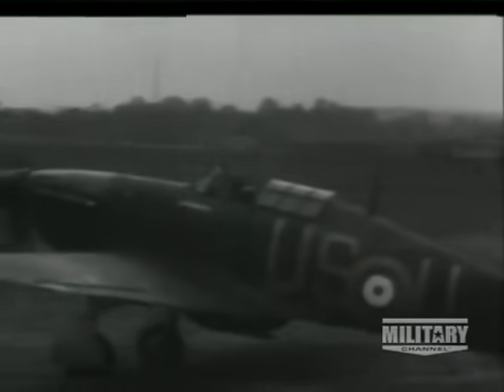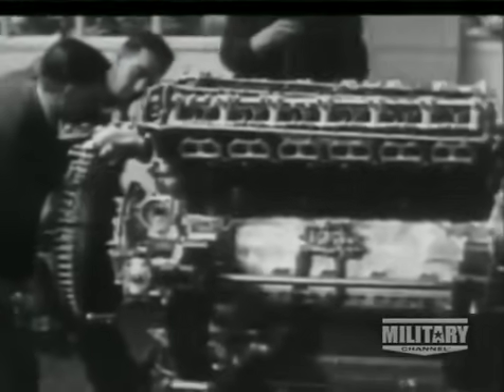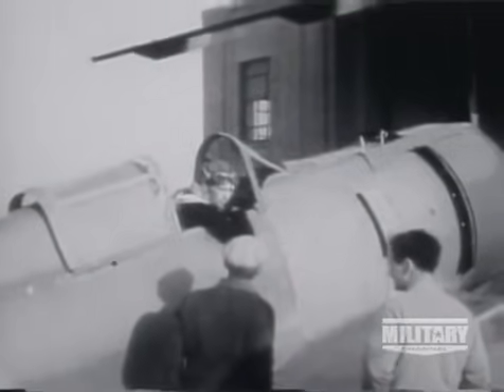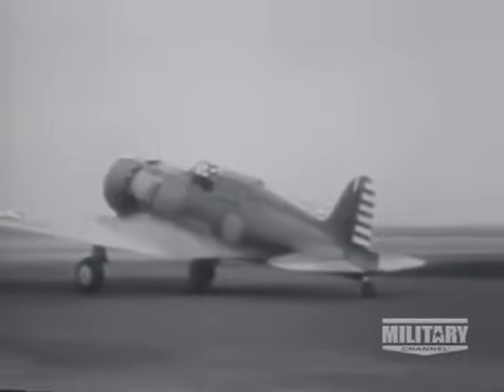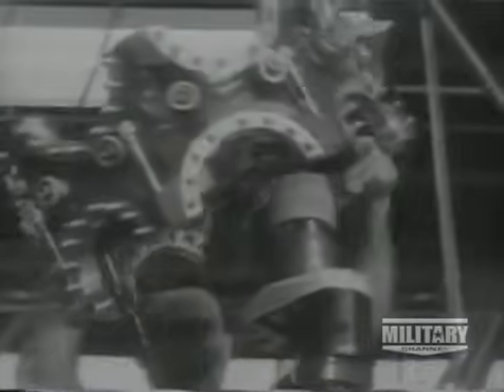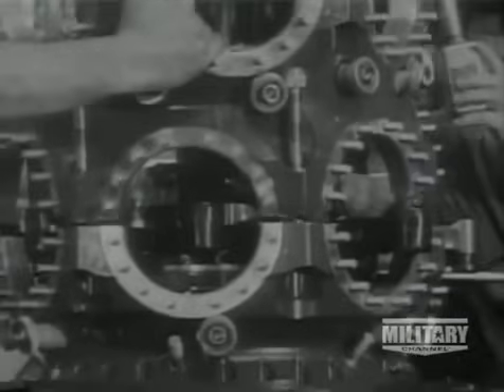In 1937, the inline engine was in almost universal use in fighter aircraft. British Hurricanes utilized the Rolls-Royce Merlin, providing a similar combination of a powerful engine and a streamlined airframe. This is the Vought 141, an American pre-war design that was never adopted, but one example was sold to Japan. Rather than using an inline engine, the 141 employed an air-cooled radial concept, with the cylinders arranged in a circle around the crankshaft. Less aerodynamic than the inline, radial engines were nevertheless popular with the American Navy, because they were more reliable and didn't require the added complication of a radiator.